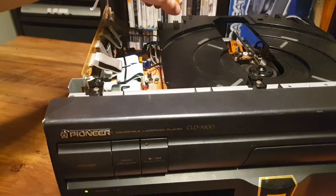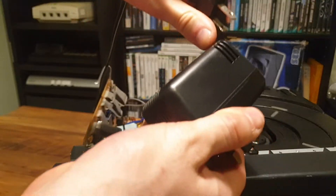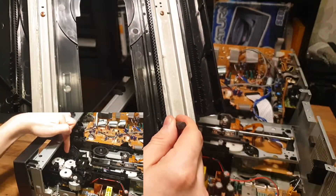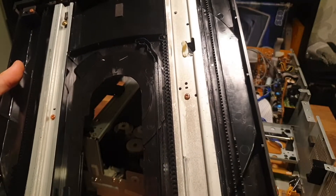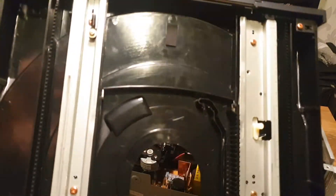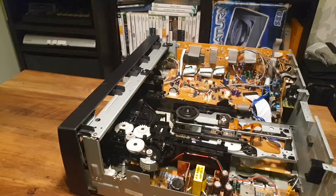The faceplate seems to fit a lot better now. However, the drive tray wiggle is completely unacceptable — something else has got to be wrong. You can see here how there is a broken section on the track on the tray. There is a peg that sits in this to control the mechanical parts of the drive whilst ejecting, and to also hold the tray shut when the drive is closed. This is very thin plastic, so I didn't want to do too much as I could make the damage worse or cause the mechanism to jam. I was also debating whether to just leave the tray alone and not risk further damage. In the end I decided to try to repair the tray using epoxy to make a replacement wall for the peg to use. The epoxy set just a little soft, but it was firm enough that I seem to have helped the issue.